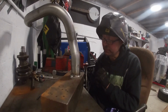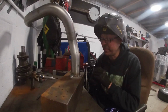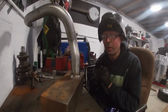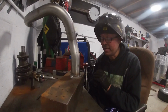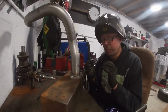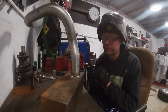Now, the way I weld flanges, everyone has a different way. I do a root pass, which basically joins them together. It doesn't have to be very tidy, it's just to add some material and join the two platforms together. Then I go over it with a secondary pass, making it more fluid, pushing along the puddle, and trying to get the colour into the weld itself.